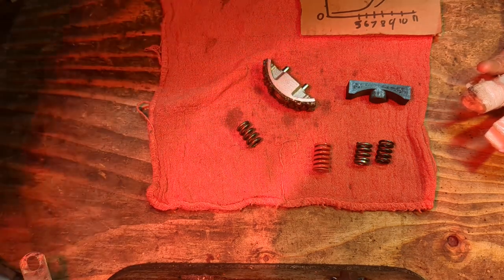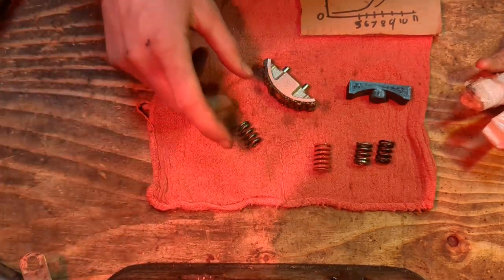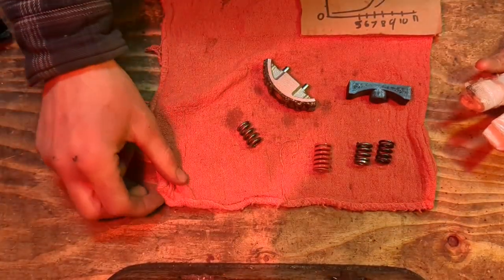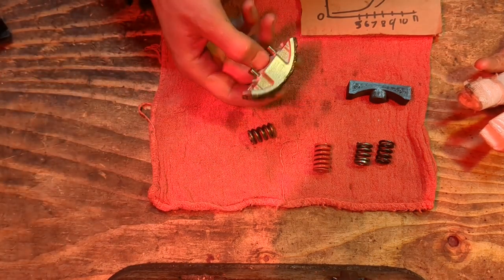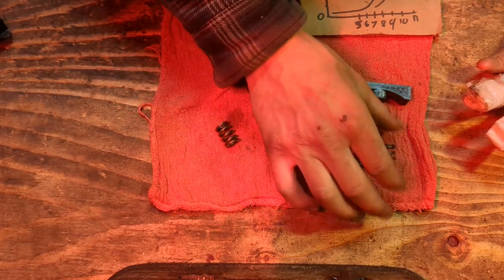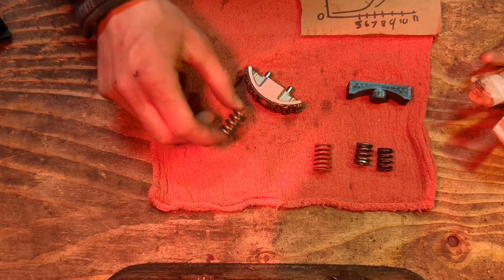And if you want to let your rider learn on a choked up carb, where it doesn't make any power at the top end, or a restricted pipe so that it doesn't hit when it does make power, you could keep this stuff relatively stock with a better spring, so you're not stuck in the 5,000 to 6,000 RPM range with the super weak spring. In my opinion, this is a totally viable way to accomplish this.